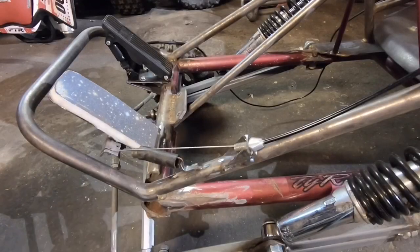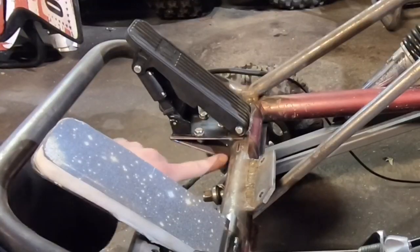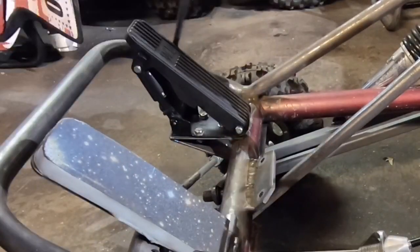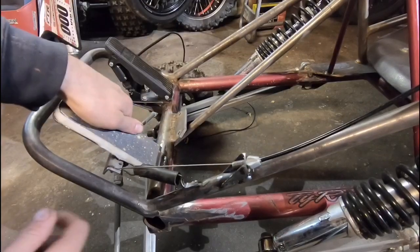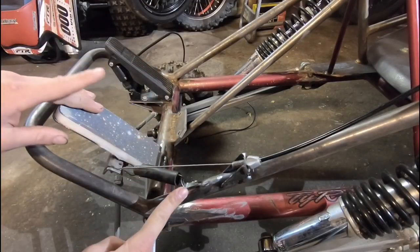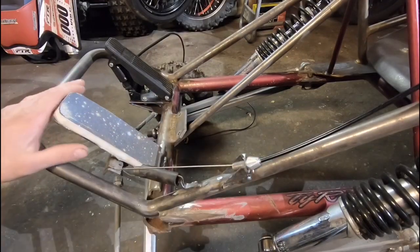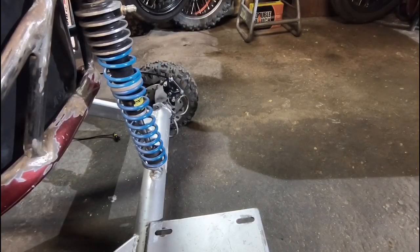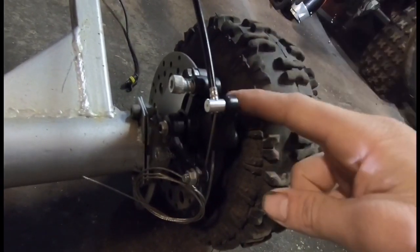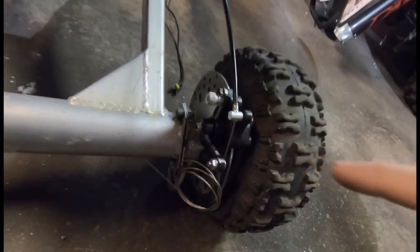The two things missing off the list were the foot throttle and the foot brake, which I finished off camera. Here's the throttle — I made a little triangle bracket on the bottom and mounted the electric foot throttle onto it, with a cable that goes to the speed control. For the foot brake, I used a door hinge with a spring to return the pedal, a stopper, and a cable adjuster. It connects to this very cheesy caliper in the rear — terrible, barely stops the go-kart, but I'll replace it with a hydraulic rear brake caliper in a future video.